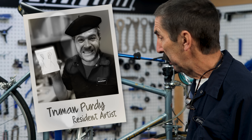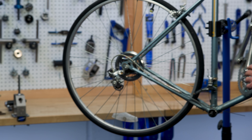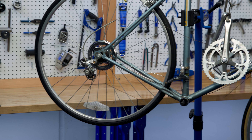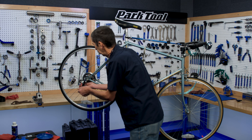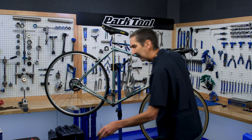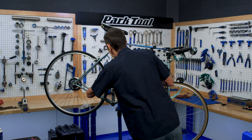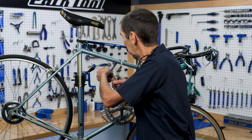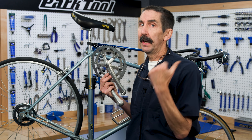So now let's look at what we have to get rid of. We're going to the one-speed. We have our single sprocket here. We're gonna have a single ring in front, but this cable needs to go away. We're gonna pull this out up here. Cleaner already, isn't it? Let's go ahead and continue cleaning here. What we're going to do is take these cranks and convert it so it's a single ring.